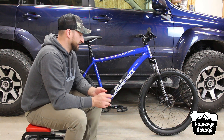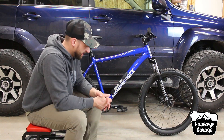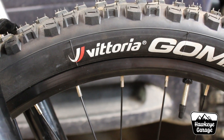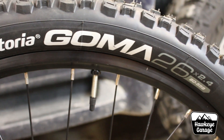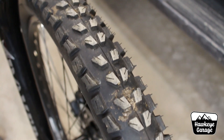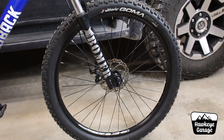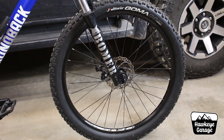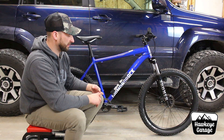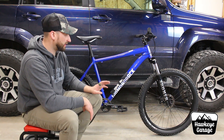Another thing that can really change the feel of your bike is the tires, and tire width more specifically. As you can see here, I've got some Vittoria Goma tires — not tubeless, I didn't go through with that conversion — but these are 26 by 2.4 width. Going from a 2.1 to a 2.4, what a huge difference that made. The bike felt more stable, more agile, easier to ride wheelies and manuals on, and it just rides so much better. It's got more cushion depending on how much air pressure you run. These tires are great for trail riding, good on concrete for family bike rides, good on gravel around the campground, and pretty much everything in between. Highly recommend these tires.